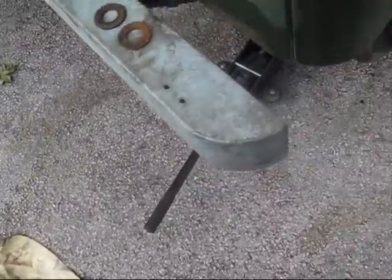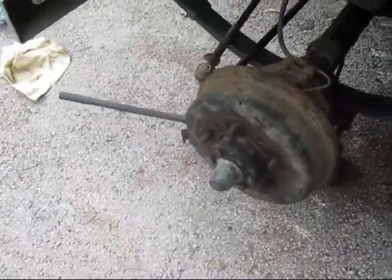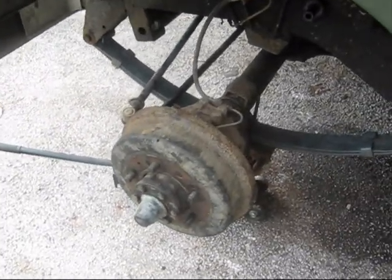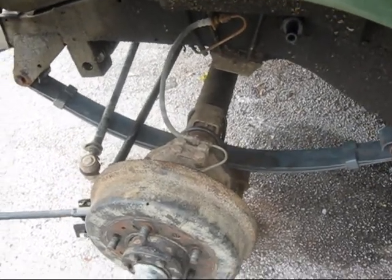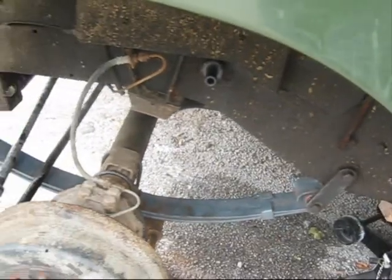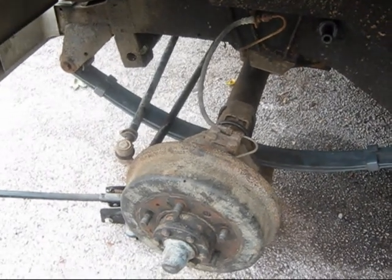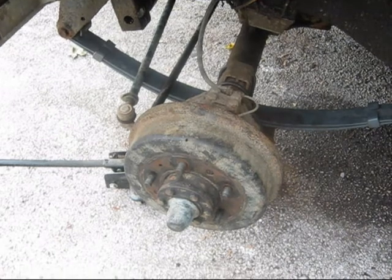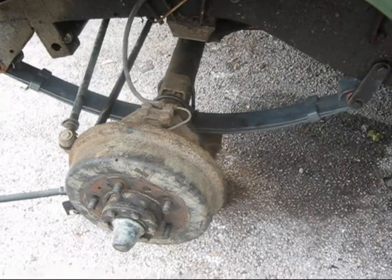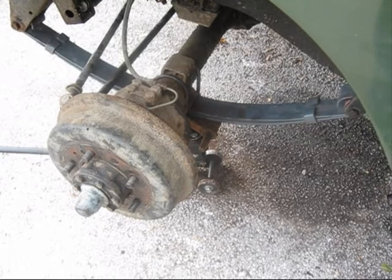Well, that wasn't easy. I had to put the strap around and pull it, jiggle it and wiggle it, and eventually got that front pin back in. I've gently tightened up the U-bolts and tapped them just to make sure they're squared and sitting right. I'm now going to put the nuts on the end, tighten up, and just go around and pinch tight. Then I'm going to check the axle oils, swivel oils, etc. I've still got to put the shockers on, but I'll do the oils now.